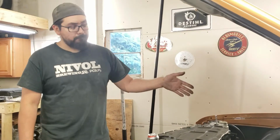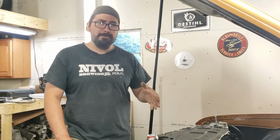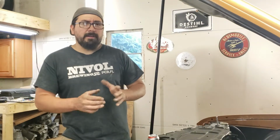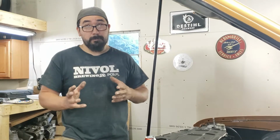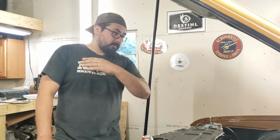It's got a Lunati solid lifter cam. It's a loose lash cam, an old Ultradyne grind. It's like a 555, 565 lift with about 241, 250, 245-ish duration, something like that. I don't remember exactly the specs; they're somewhere in my log.